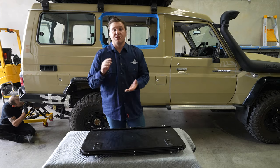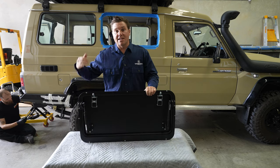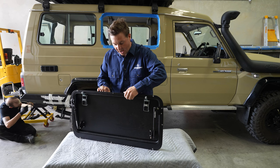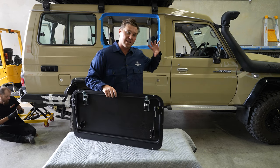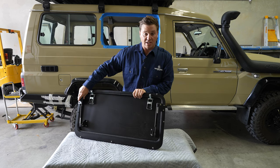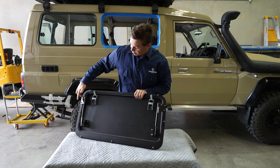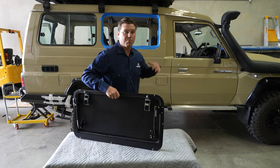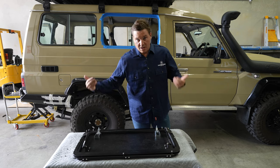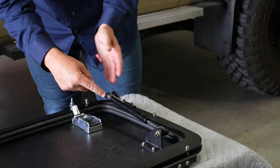Our gullwing comes in a box pretty much fully assembled, which is really handy. That said, you do need to pull off these two brackets and the backing ring. The way our gullwing is designed, there's a full plate on the inside and the outside, keeping everything secure and in line with the two gas struts. We're going to undo these nylock nuts across the whole way around, pull the two brackets and backing ring off, and then place the gullwing itself in the window of the car ready to mark the holes. I've flipped the gullwing upside down on a nice soft bench so the front remains clean.